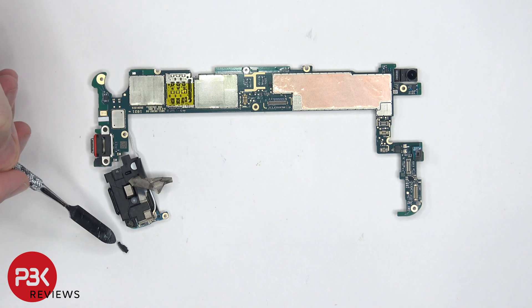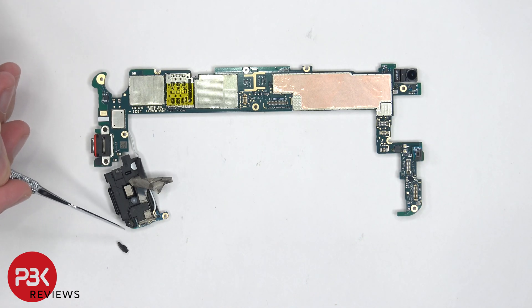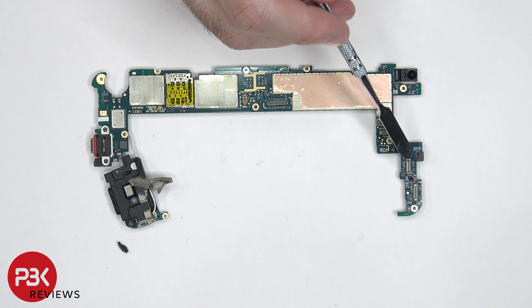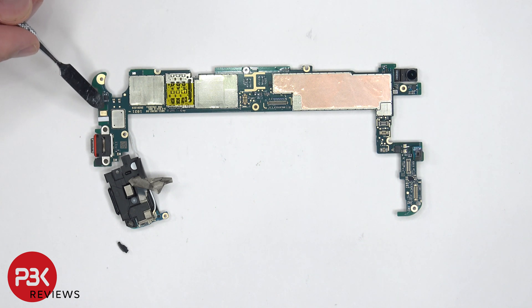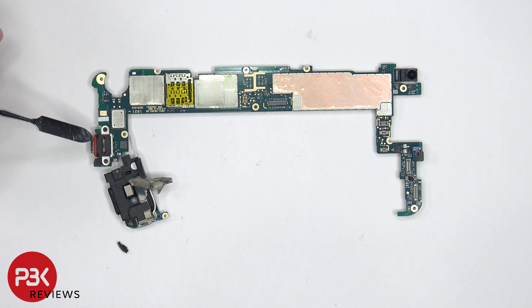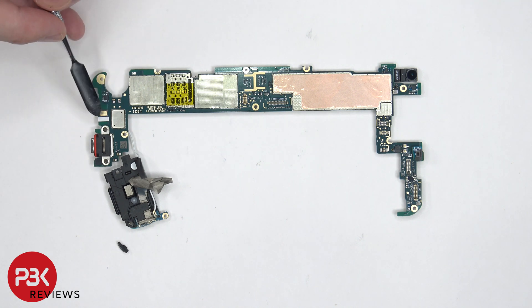There is another plastic bracket which goes on the corner by the speaker assembly — when reassembling, don't forget to put that piece in. Taking a look at the motherboard, we have the SIM card reader located here, copper tape on top of the shield, the proximity sensor on top, and the primary microphone on the bottom. The charger port is soldered onto the board, so making repairs on it would be difficult. There's a red rubber gasket around the charger port, and another liquid damage indicator — a white sticker — located right next to the primary microphone.